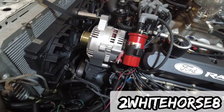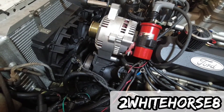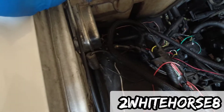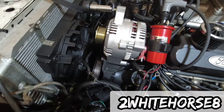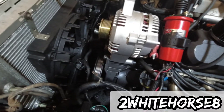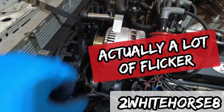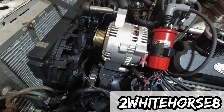For the original alternator, which I was still wanting to change out anyway — it was actually this piece here, the regulator. It's an old car, so it has that external regulator, and I think it was the regulator that messed up and not actually the alternator. If I wasn't trying to change to the 3G already, I might just buy the regulator and put the old alternator back in. But this one should eliminate the flicker I had in my LED lights.